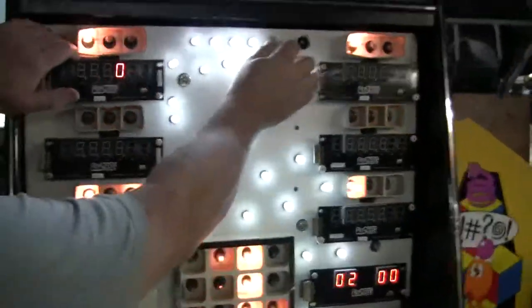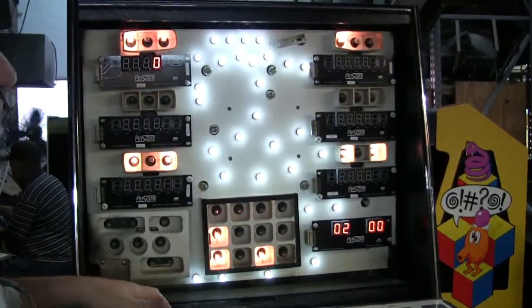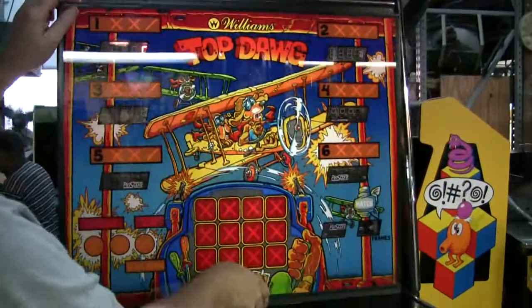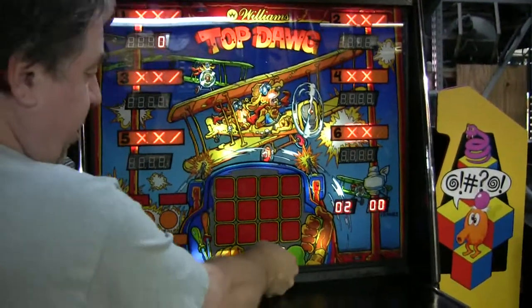We've cleaned the inside of course. There's a lithium battery that lasts about 6 years with our quick connects, so they're easy to change when they fail. We've flowed solder around the edges. The power supply has been rebuilt with all new capacitors. Just 5 volts — the LEDs are also low voltage, so our game uses a lot less electricity than on the original amperage sheet.